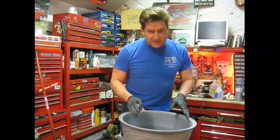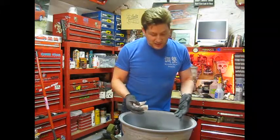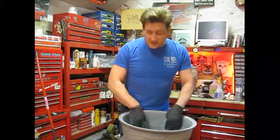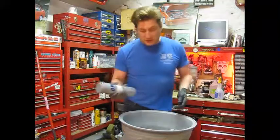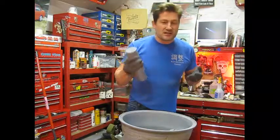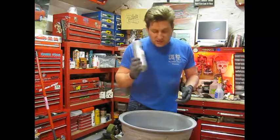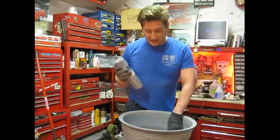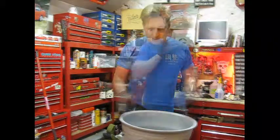I'm going to paint the insides first, just trying to paint them all together. Then I can mask off the insides once they're fully dry, and do the faces and get a nice smooth finish on the faces, so there's no overspray going on the inside and spoiling the finish. For the silver, I will be using a U-Pol wheel silver. It's in an aerosol, so that everybody without equipment like spray guns and compressors can do it. I'm just going to prove that you can get just as nice a finish. If your prep's right, you can get a nicer finish with an aerosol than you can with a normal paint gun. The lacquer will be done with a proper paint gun because I want a nice smooth show finish.